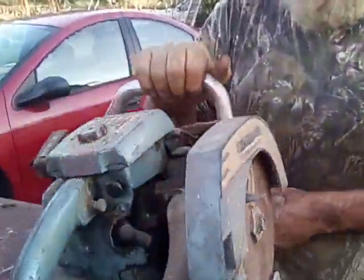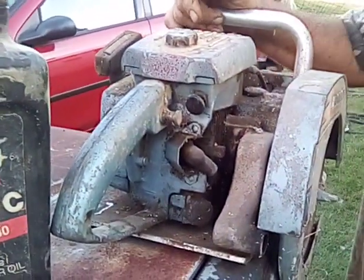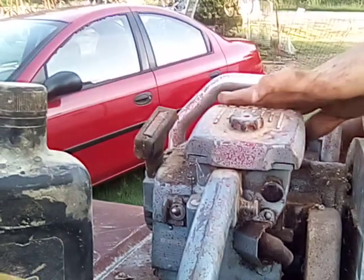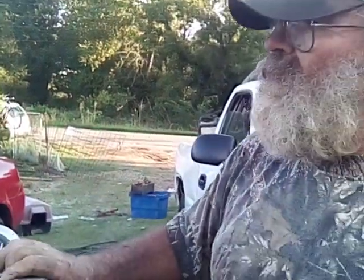Needs a good cleaning — take it apart and clean it up. That's gonna need cleaning, and it'll need a kit and a carburetor, and new fuel line. Probably take it apart and put new crankshaft seals in it. The cylinder and piston might be good — hard to say. That old boy Leon's chainsaws — he can take one of these Homelites apart with his eyes closed. He sells the parts for them too if you need something. I can take them apart and fix them — I ain't as good as some people, but I can manage to get them going every once in a while.